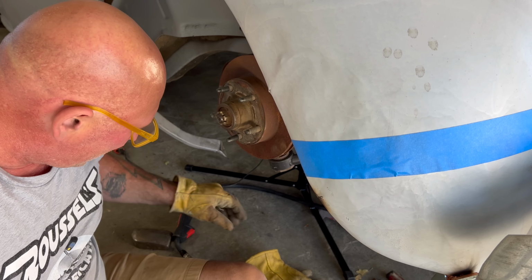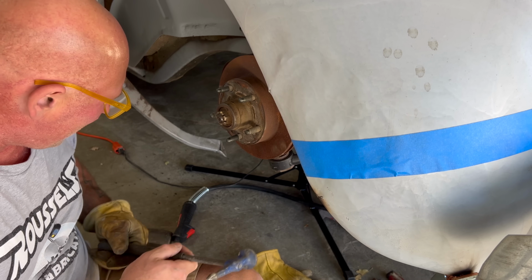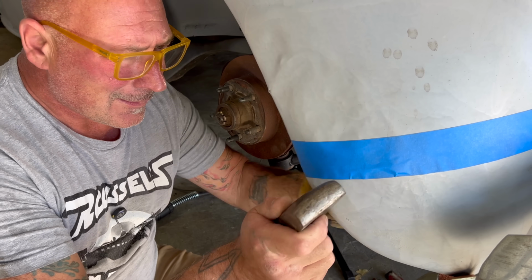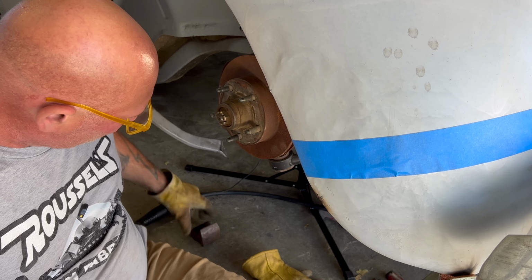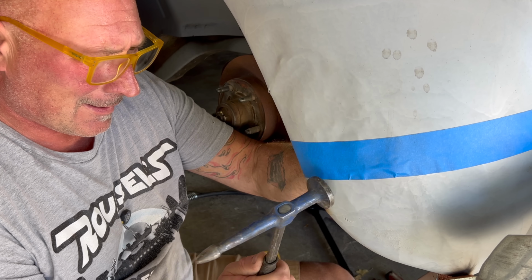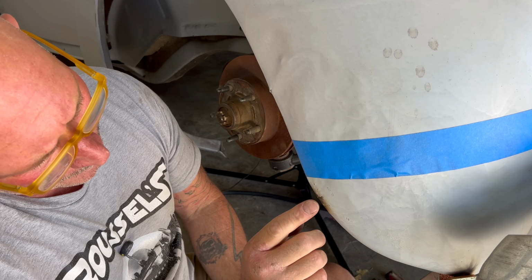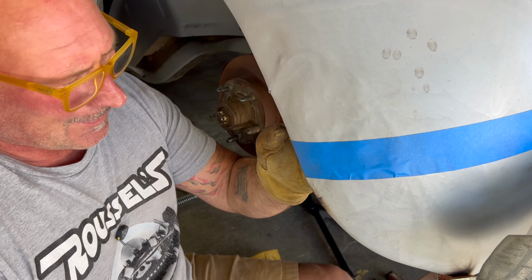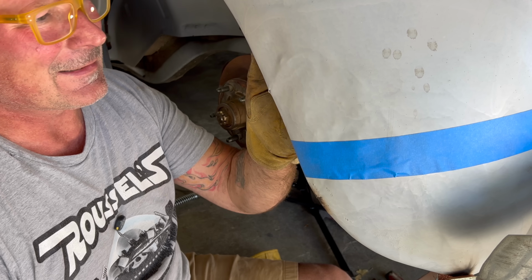It's a little hard to see at this angle, but let me assure you, this is a considerable dent. So I'm going to start by trying to pick that out. Look at that. Cool. Now that's out. Try to just dress that up a little bit. That's cool. I think we're going to trap this area because this has to puff out now. That's where I was thinking about using maybe that planishing hammer, you know, the air hammer thing. Although maybe we'll wait, that way we don't have this weld bead to contend with on the inside.